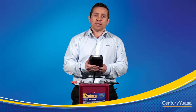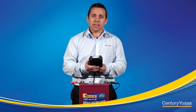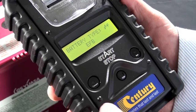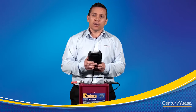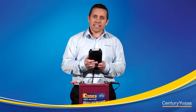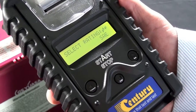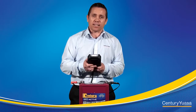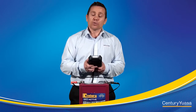The battery type selection will now display. Using the direction keys you can choose EFB or AGM flat plate. Select EFB and press the enter key. The select rating screen will now display. In Australia, batteries are rated at CCA or cold cranking amps — this rating is classified under SAE. Select SAE and press enter. You will now be asked to set the capacity or CCA of the battery; select the battery's capacity using the direction keys.